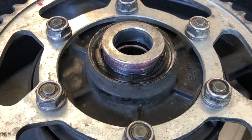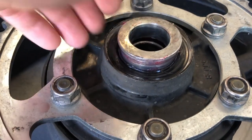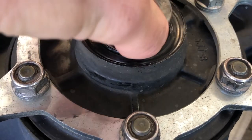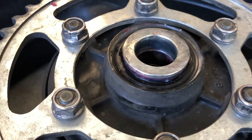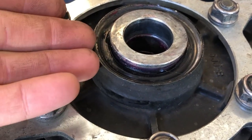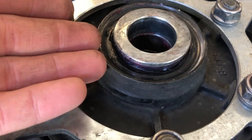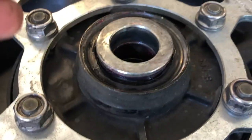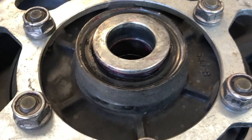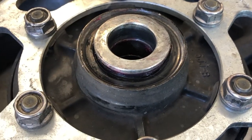You might be asking yourself how much is too much grease? Basically, you don't want grease slinging out and away from the wheel. I've got it packed into the grooves here, but when I put the spacer on you shouldn't see a ton of grease. You shouldn't have a bunch of exterior grease that could sling onto your drivetrain or worse onto your brakes on the other side. It shouldn't be visible, and it should basically prevent water from getting in through the seal — that's the main job of the grease.